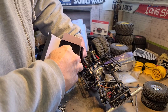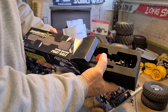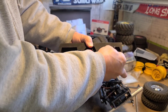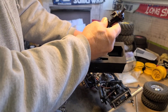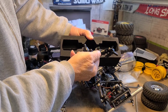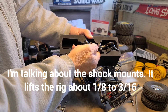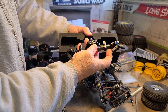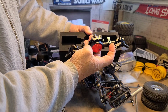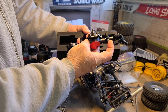They come pretty well oiled, and I haven't had to shim the ring and pinion so far on any of my sets. They have a great turning radius. You pull these off of here — or you can even leave them on for a little bit more lift. They are literally leaf spring ready just the way they are. It's the same width as a trail finder, so if you want to run these axles on a leafed rig, they bolt right up very easily.